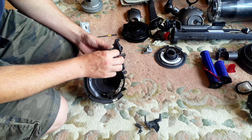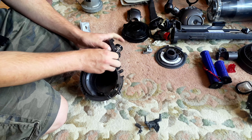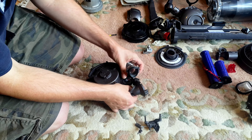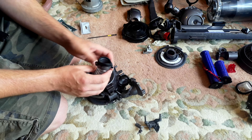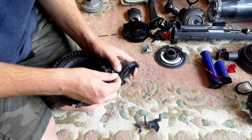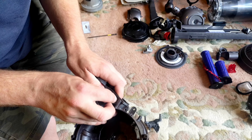That bit goes there, like so, with that part clicked into place. Trying to push the spring in — there we go. Don't put the spring in yet because we need to put the short side of this hose into here whilst pushing that side on there. It's certainly a lot easier doing it like this than when the machine is together, although even this way is just a little bit fiddly, especially with a brand new hose. But eventually you'll get it seated like so with all the bits nicely aligned. Now, we can line up this spring here.